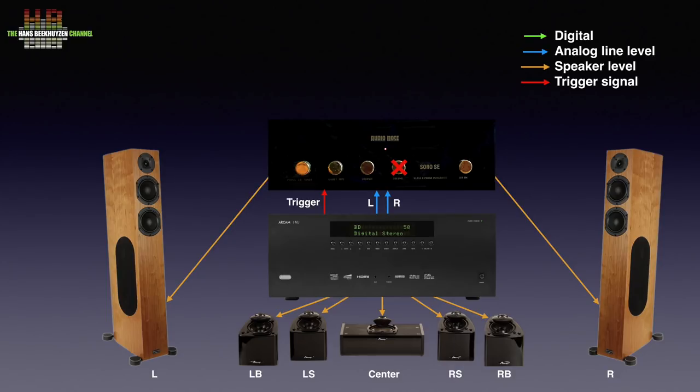The center speaker is the Mirage OS3 CC and the four surround speakers are the Mirage OS3. These Mirages have good power handling, start at 70 Hz which is sufficient for surround and center, and are omnidirectional. An omnidirectional speaker for the center gives far less coloration off-axis, so the dispersion is even better than the viewing angle of my Panasonic Plasma TV. By pure chance the tonal balance of the Mirages is not too far off from the Audio Physics. They don't offer the same quality, but for enjoying video with surround sound they are the best compromise — aesthetically, financially, and sound-wise. I should not forget to mention the fantastic REL B2 subwoofer in the setup.